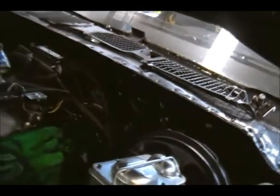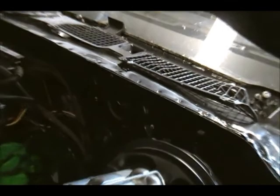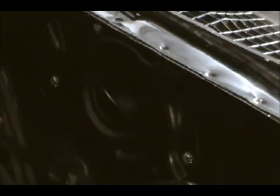These actually hide down. So there's a special adapter plate that you should have, and I did have one, and I thought I lost it, but I found it, so I painted it up and I bolted it onto the firewall. I don't know if you can see it, but that's the hideaway plate. Without that, you won't get the wipers to go down, because what it does is it takes the pump body from the original holes and turns the pump a little bit more, so you get that little extra oomph.